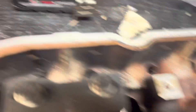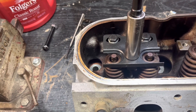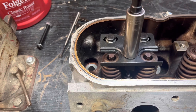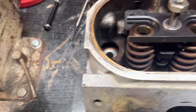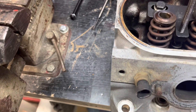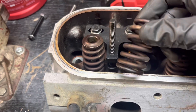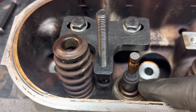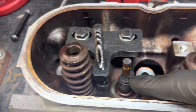Take those right out of there. When you decompress the springs, you come down, it pops down on here and you take the two little keepers out. While we're here live, we're going to back this off — and then that'll release the springs. There you go, she's all the way. Take the nut off — boom. Watch out for the washer; probably going to replace the washers. So right here you're going to want to keep these — you're going to need these little guides. Then you take the honeycomb out, and right down there is the seat; we're going to change those out too. That's the seal — the seat seal on both sides.